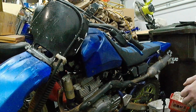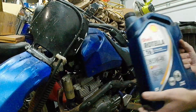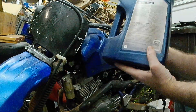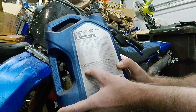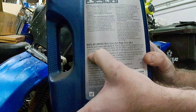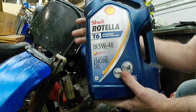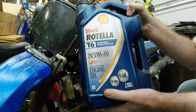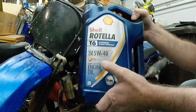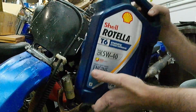I'll let that drain, close it up, and add fresh oil. What I use is Rotella T6 5W40. It is JASO MA and MA2 rated — see right there? That means it's safe for wet clutches, so this is 100% safe for a wet clutch. And this is a good temperature range for almost all of your small engines. Why spend more? This stuff is great.